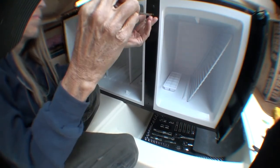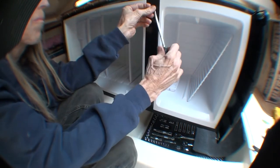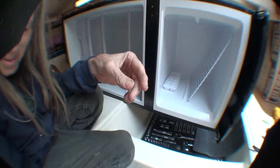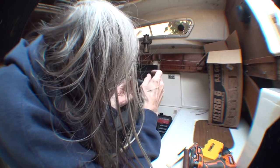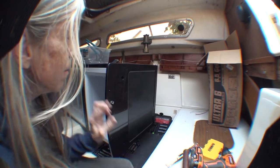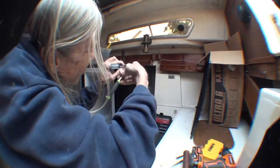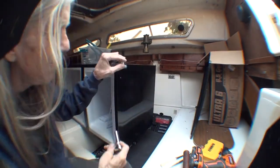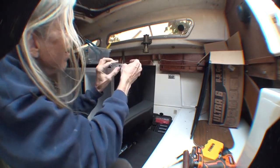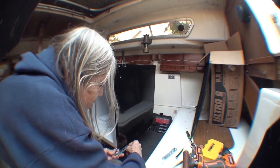These little plugs have to be removed because they cover the holes where the lower hinge piece is going to be moved to. The upper hinge pieces are hidden underneath a plastic cover that is the lid or top of the refrigerator, and they're basically just like the ones at the very bottom. Two bolts hold in this steel piece — there's one on each side, and one of them is flat and one has the hinge pin on it.